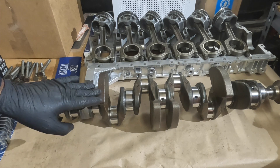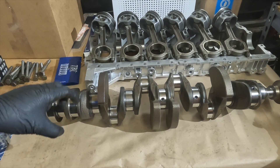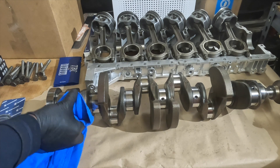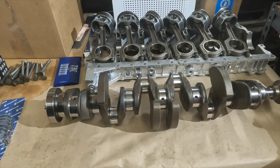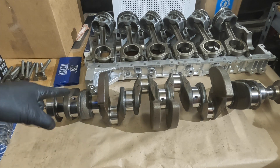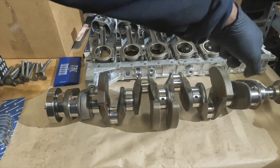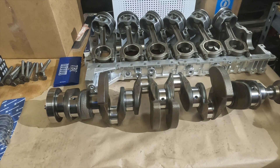We've got the N55 crankshaft here. The crankshaft has already been measured between the main bearings and the connecting rod bearings at zero and 90 degrees for taper and out-of-roundness — you can check out that video in the series. The crankshaft is dimensionally good. It's been polished and I've blown out each of the oil passages to make sure there's no blockage from the main bearings to the rod bearings. This crankshaft is ready to be installed.